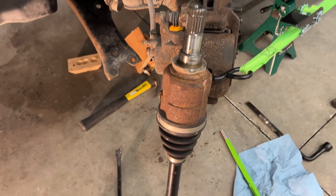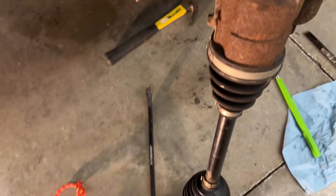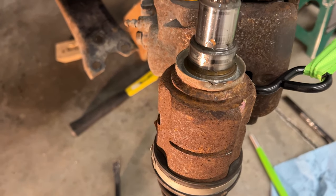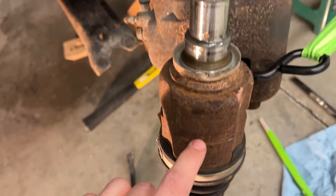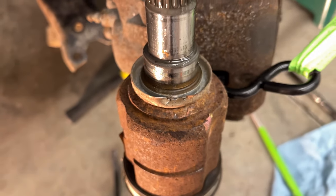I want to warn you: when prying on the CV shaft, don't use a crowbar on the seal surface — that will damage the seal. So now I have to fix that before putting it back in. Learn from my mistake. Probably the best approach is to buy a slide hammer that fits before you start. I was able to get the CV shaft out using a piece of rope tied around the end and a sledgehammer — it took about 10 good slams but eventually it slid out. If you do use a crowbar, put it on the correct lip, not on the seal surface.